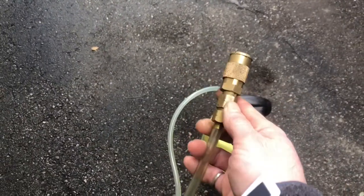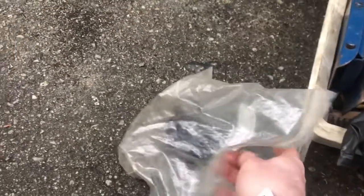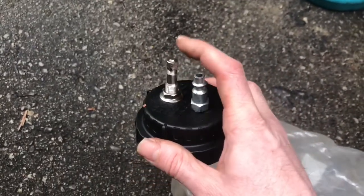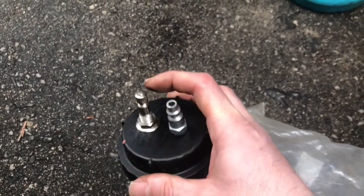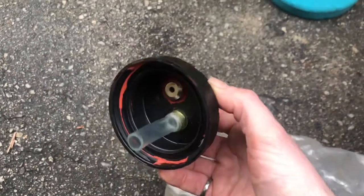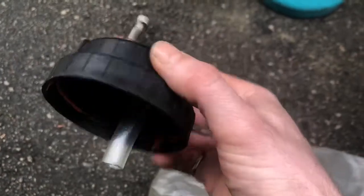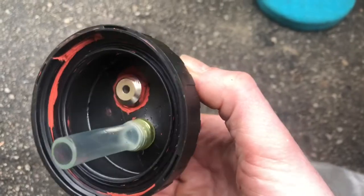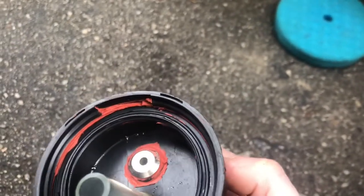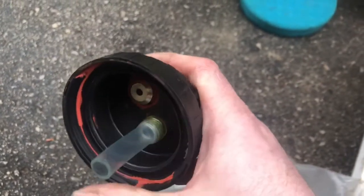You may be wondering why I've got a compressor fitting at this end — this is where the magic happens. Head to the junkyard and, for every vehicle you own, get yourself a brake fluid cap. I have two different variants for my cars. All you need is a male compressor adapter — drill a hole through the cap. The key is to drill a hole that allows you to screw that adapter in and still retain some kind of pressure. I used some material to seal around the sides, although I didn't need to for this fitting — it ended up being just fine airtight-wise.